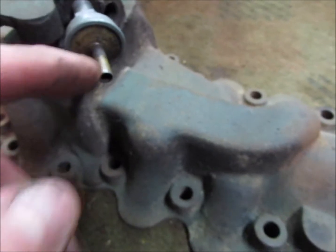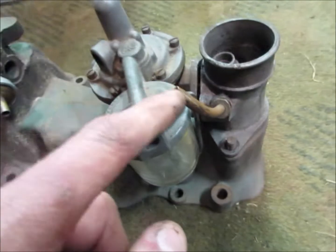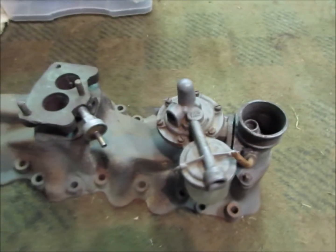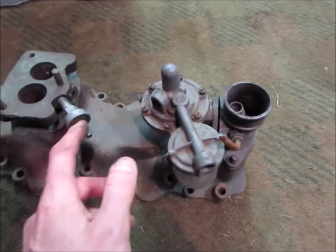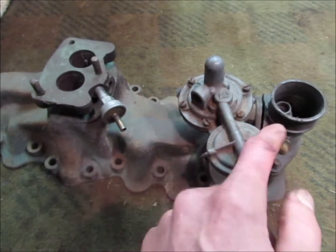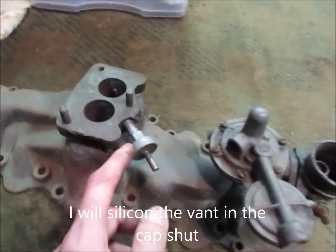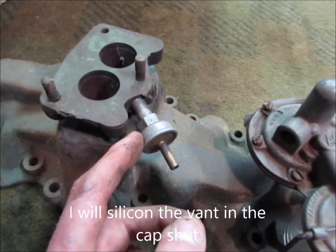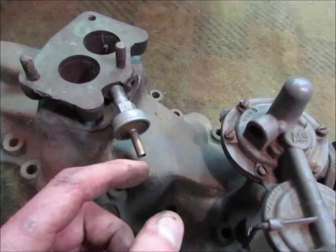This one I think ran from here to here and also to the front here. And possibly that's the Bren gun one — I'm not 100% sure. But I am going to try and use this system on my motor. I'll just run it to here and see how it goes. This valve's disc has collapsed, so I'll fit a modern one off a Japanese car or something — I'll use the PCV valve.